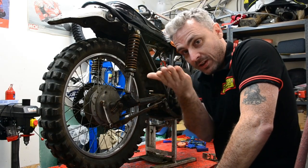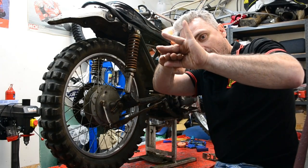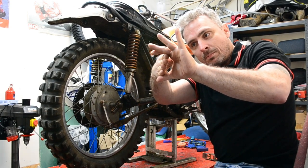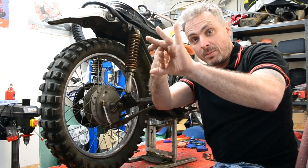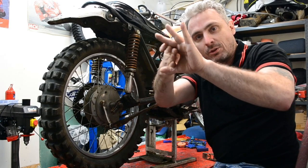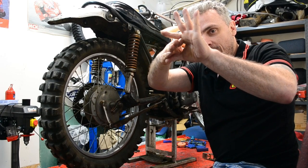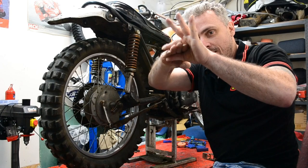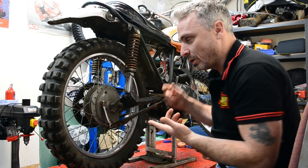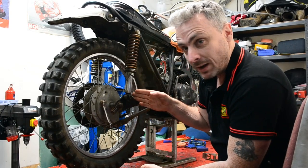Let's say this is the cam - the brake shoes are shaped like this, and when it turns it forces the brake shoes apart. But if it goes too far and you let go of your brake, they just stay there - there's no spring action to come back. It needs to just turn so far that the brake shoes work and then return with the spring. So it's either lubrication or your shoes are worn out. We're going to strip all the back of this down, repair the brakes and change the rear tire.